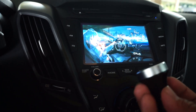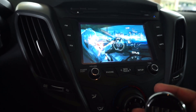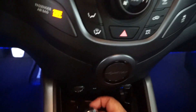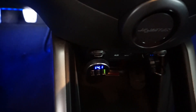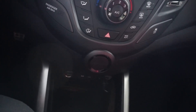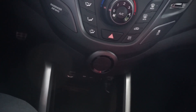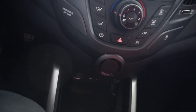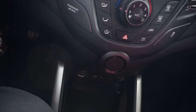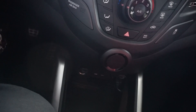A lot of people buy USB adapters for their vehicle. This one is kind of neat because it has a little trick — it has a built-in voltmeter display. I'm going to plug it in. As you can see, it has a little tool. Sometimes they will be off, not entirely 100%. The car's on, so 14.1 would be technically a good reading. I know you guys saw the USB hub with the voltmeter, and that's really cool — a very discreet little display, especially if you need extra USB ports.